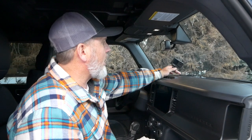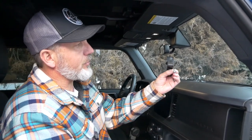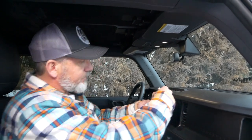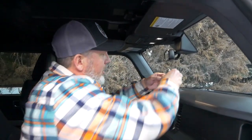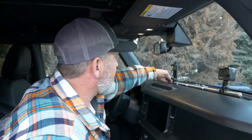When we first got the Bronco, because we do a lot of filming, I knew that this jack right here on the accessory port was probably going to fit a camera mount — which is quarter-inch 20 thread. You can get the adapters by themselves for less than $3 on Amazon that'll fit right in there. We just got a piece of all-thread and cut it — you can also use a bolt and cut the head off. Put a quarter-inch 20 all-thread through the GoPro housing or camera mount housing all the way until it stops, turn the screw up just a little bit, tighten it up, and now we have it where we want it. We've been doing this for over a month and this thing is super sturdy.